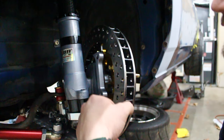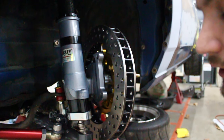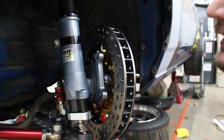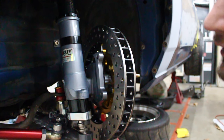Now that the hub is assembled, we're going to put the caliper on the mounting bracket. Just like everything else we've bolted on, we're going to Loctite these bolts and torque them to 30 foot pounds as printed on the face, so that we don't over-stretch the threads inside this billet.